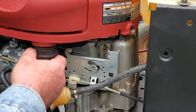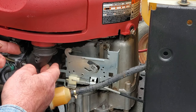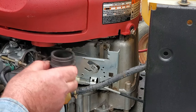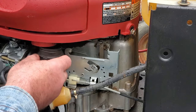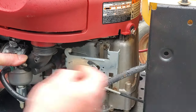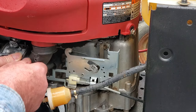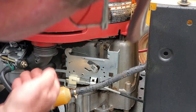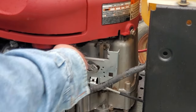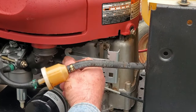Now it's not sticking at all because this part is able to fit inside of here. I've seen this before — this isn't the first time I've run into this with a replacement carburetor. It can be very frustrating because you put it on and you're really not sure why it sticks. You look at the linkage, make sure the linkage isn't hitting anything, and you try to take a little plastic off of that — and it ends up being that it doesn't fit inside this adapter.